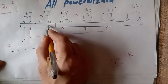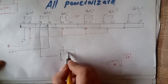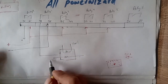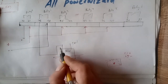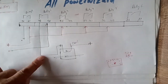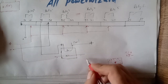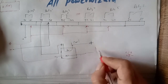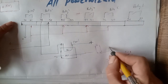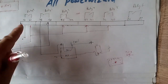For example, we use a negative supply for the fuel control relay. Take a negative wire and provide it to pin 58, and then out from pin 58 to control the fuel relay. For the fuel relay, it's the NO contact — provide the negative to the relay coil side and provide positive to the other relay coil side. When the controller sends the negative supply to the relay, the relay will energize. Then take the positive supply and provide it to the relay NO, and then out from relay NO to the fuel solenoid. One side of the fuel solenoid is grounded and one side is positive.